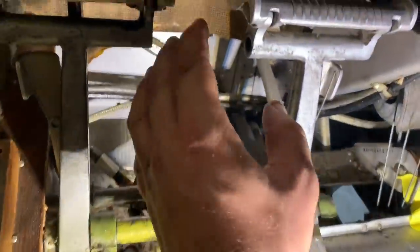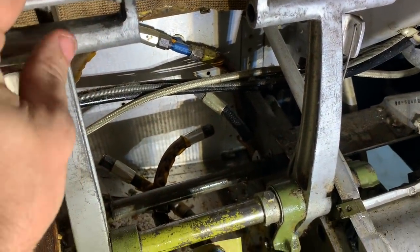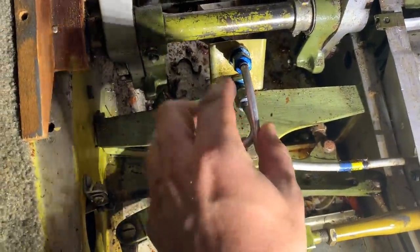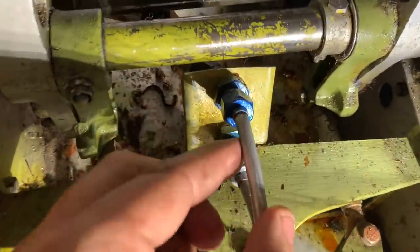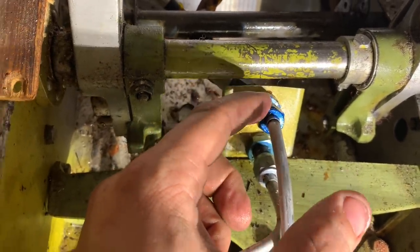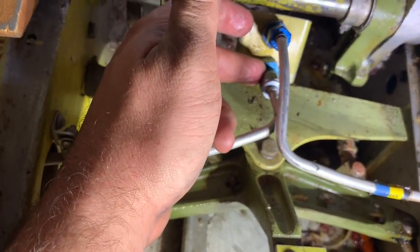Both of those have been removed. It's actually a good chance to inspect the back side of the pedals with the brakes off — it's easier to see them. Nothing major, a couple nicks. But what's interesting is there is hydraulic fluid all over this line and all over this plate, and that doesn't make any sense based on it leaking out the reservoir for the brake cylinders. I'm thinking the angle this is bent to is causing this line to leak, so I'm going to take this line off and we'll pressure test it to see if this fitting is leaking, because I already suspect it is most likely leaking.